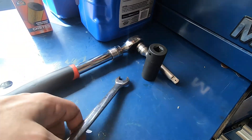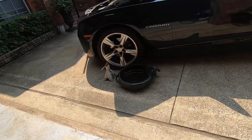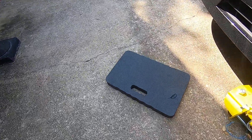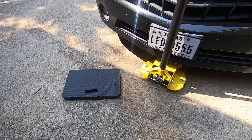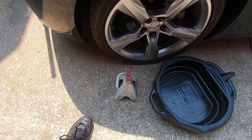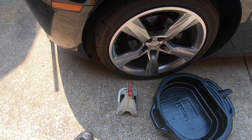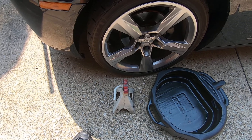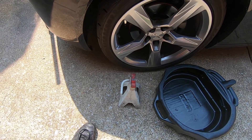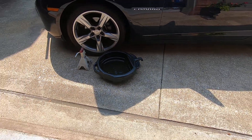And a 15-millimeter wrench for the oil plug. So we're going to jack the car up — got the jack ready to go. You gotta have a kneeling pad; that'll save your knees. If you jack it up, use a jack stand. You don't necessarily have to set the car back down on it, but place it under the car so when you're sliding in and out from underneath, just in case that jack fails it comes down on the jack stand and not you. Oh, and an oil pan. I'm going to get this jacked up and get it ready to go.